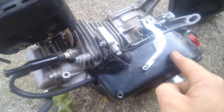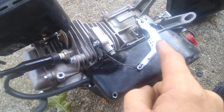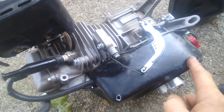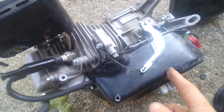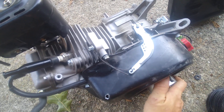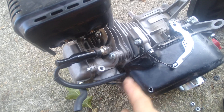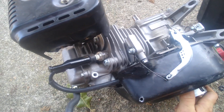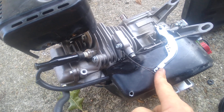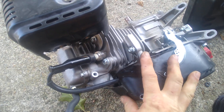It'll just drop down into your motor. I completely ruined this motor because I got in a hurry and forgot to tie this armature off — it was just back there flapping. When I dry fired it: clack, clack, clack — it was done. Ruined my compression. I got a few miles out of it, but the second I put my performance carb on it, it killed it totally. No compression, thing won't even start — all because I didn't tie down my governor.